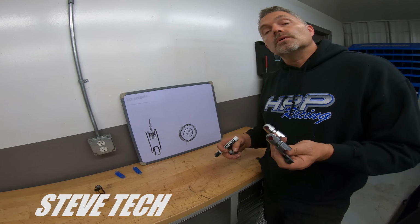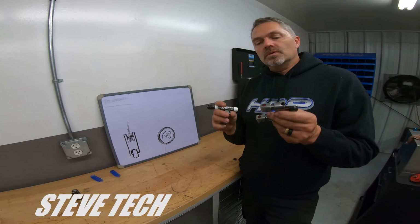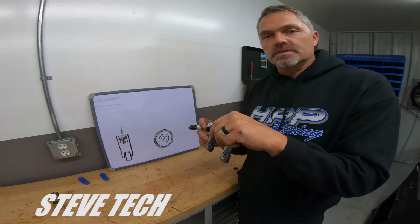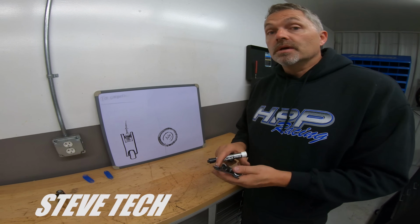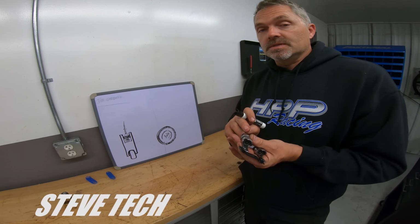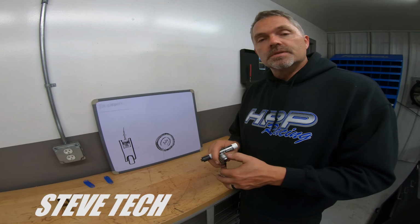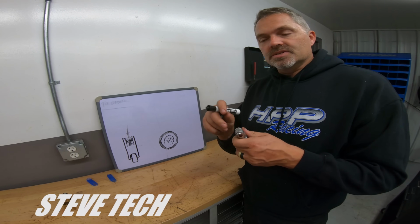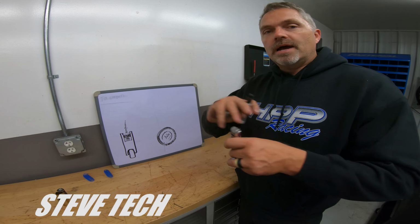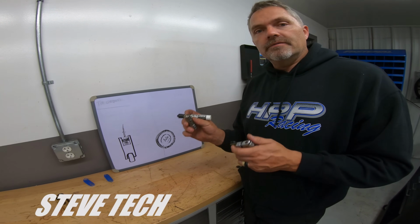If you go back to our lashing valves video, I tell you, you're only checking to see if anything's broke. Could care less if this thing was a 1,000th or 2,000ths difference when you're checking valve lash. But if this thing is 10 or 20,000ths different, you better go find out what's broke. A lot of times it's going to be the lifter wheel going away. But if this lifter wheel breaks or has any problems with the bushing in there, it just sends a few bigger pieces in the pan. Not nearly as big a deal as sending a whole shrapnel full of needle bearings in there. So I really like to have all the bushed lifters.